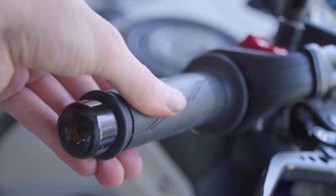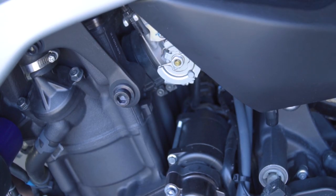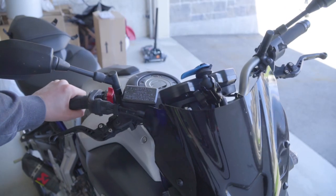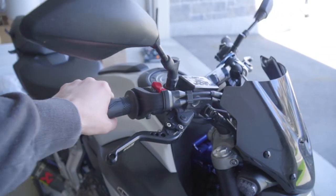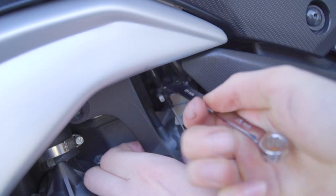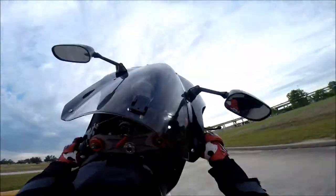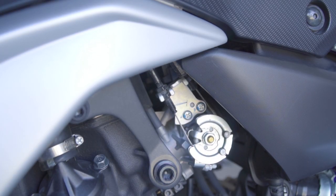Warning: this next part is not recommended for most people and is considered highly dangerous by internet experts and motorcycle manufacturers. What I'll be talking about is the throttle free play, or the lack thereof. Most manufacturers recommend having around three to five millimeters of throttle free play, and in my experience that just adds less precision to your throttle hand. The reason we leave a little free play is because the throttle runs on cables connected to the handlebars, which spin and can pull on the cable, causing the bike to engage the throttle even if the grip is not turned. This can put you in a pretty bad situation. But in my experience, you can achieve almost zero throttle free play if you take your time adjusting it — though I do not recommend this for everyone, as hitting a bump on a more powerful bike could cause a real messed up day. In my case, I'm confident in my abilities, so I'll go ahead and remove the throttle free play.